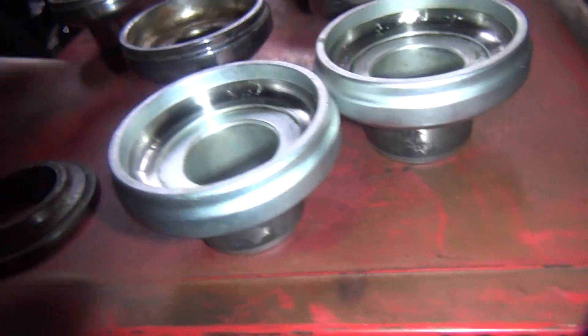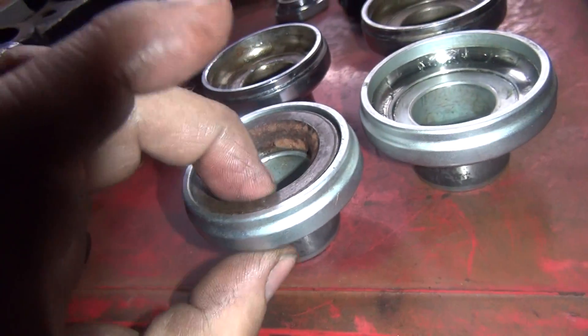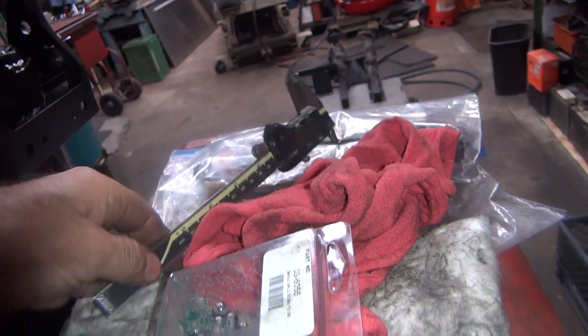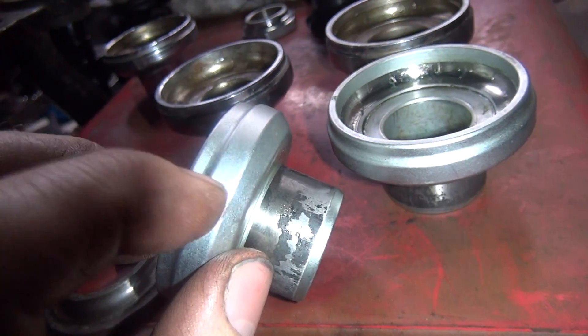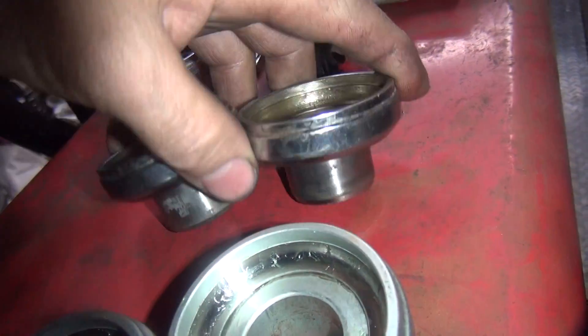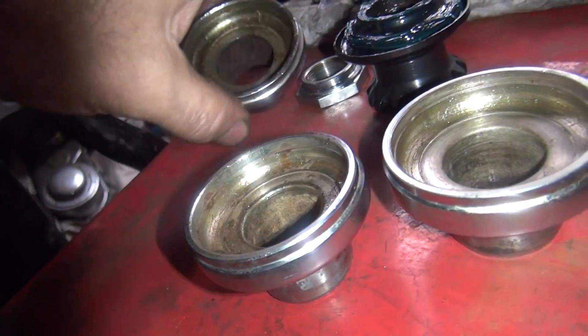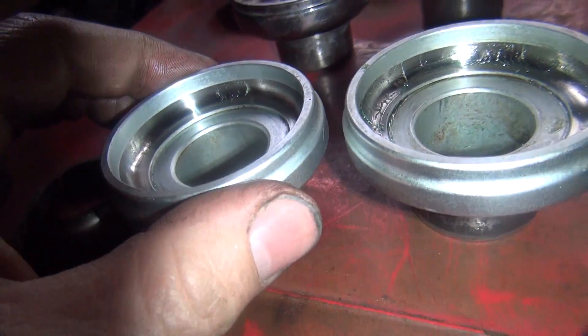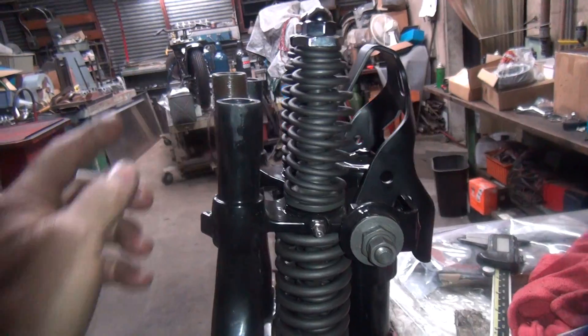The next problem is when you put it in the cup over here — you take your bearing right here, you stick them in here, you stick your bearing race up in there like this and measure across the face with your caliper, and you get a dimension. These are the repop cups. This is the original Harley cup, mine. These here are the two repop cups that came out of the 41 frame. So this here was one dimension; you put this in here and these are forty-three, forty-five thou thicker, which moves your nut up another ninety thousandths.